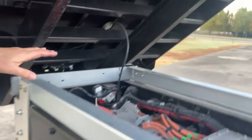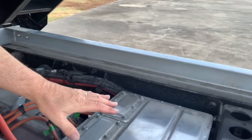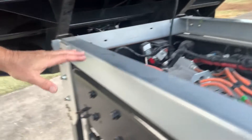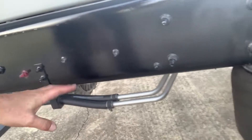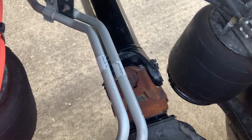We're just going to track the lines that come back to cool our engine and our regenerative brake power inverter plate. This particular system flows through rubber hoses into the tubing. That tubing on the inside flows up and around the drive shaft to keep away from that U-joint.